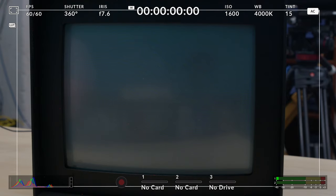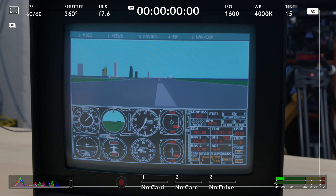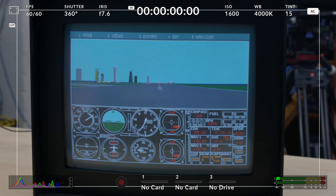And, oh wow, it actually did a really slick job. You couldn't see it, but it just changed scan rates. Now instead of scanning at 15 kilohertz, it's scanning at 22. Most likely, it's possible the card did the conversion, because this is a Super EGA card. I can't be 100% sure. But at any rate, this is the same color depth.